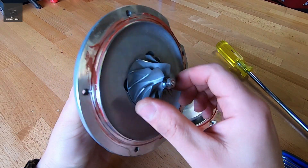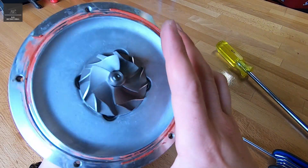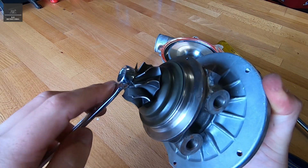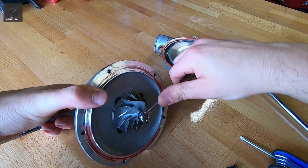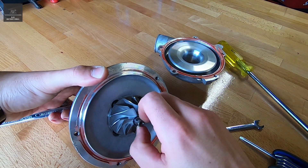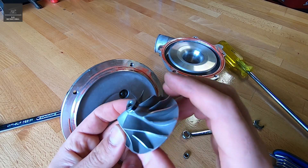So let's remove this turbine here — that's done through this screw — and that will give us access to some concealed torx screws, so we can take this part off the actual body. I'm just going to use a 12mm and an 8mm ring spanner. The 12mm will go onto that exhaust point there, and the 8mm will go here. Now this is counter-intuitive — it's actually backwards, so to undo it I have to go the opposite direction. There we go — so that's the air inlet turbine, and you can see the various vanes and the different angles that they are pitched at.